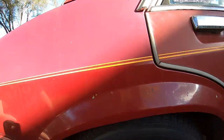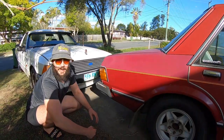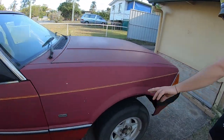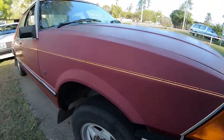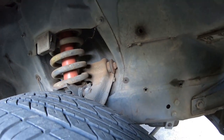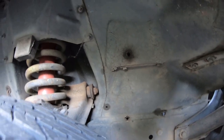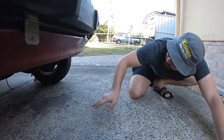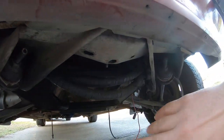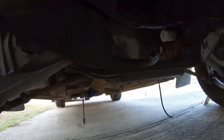While you're under there, pop your head under and look along the chassis lines of the car for any damage. Check if the chassis has been hit anywhere, from the front end or the back. Come down to the front — looking around the guards, look for any wrinkles on the flat areas. Come to the front, look under it, and look for any hits or knocks on any of the suspension arms. Make sure the car's looking straight — the crossmember, everything. You can also see the seals from the front; get down as low as you can.